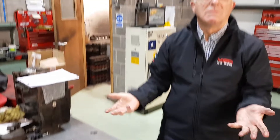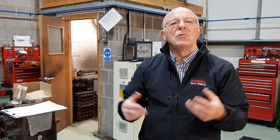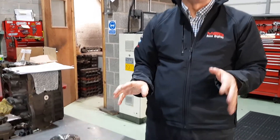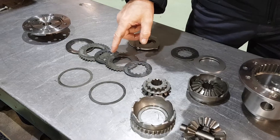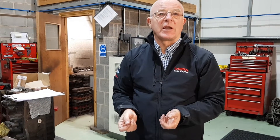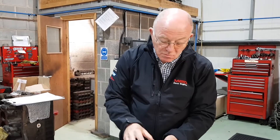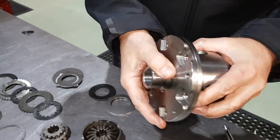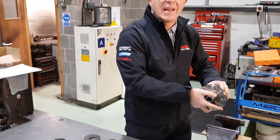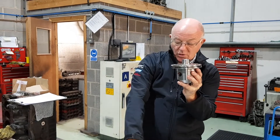It stops the wheel spin and increases the drive. It looks complicated, but if you can rebuild an engine, you can rebuild one of these. What you must do is take your time and make sure it is scrupulously clean, because any piece of dirt that goes between these clutch plates will score the clutch plate as you build it, and then you'll get a false reading when you torque the diff to check it. On reassembly, as we showed you how to disassemble it, you must put it back together the same way. Once it's all back together, you'll find you have a gap — put it in the vise, compress it, put the screws in, and then tighten it up. Otherwise if you do it up on the twist, you'll put pressure on the cross shaft.